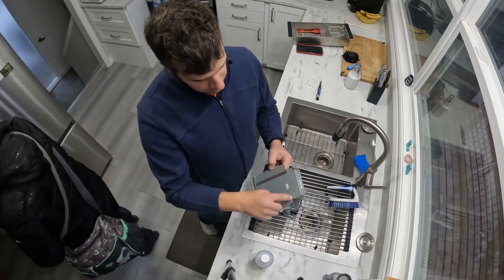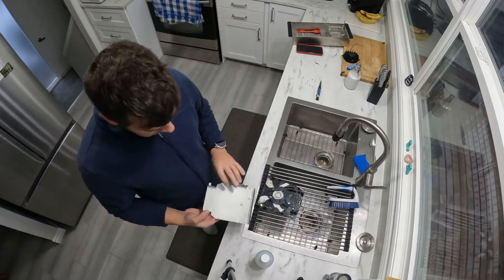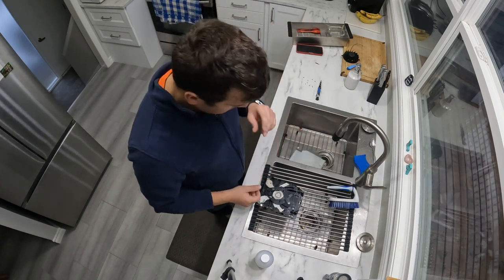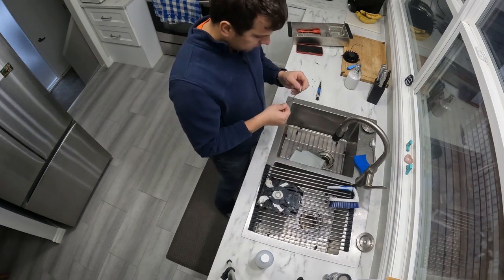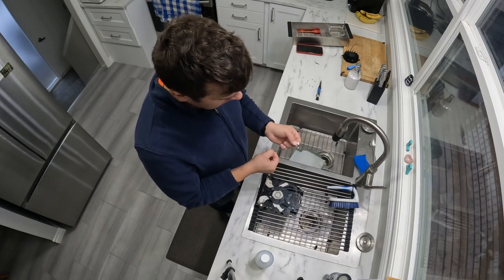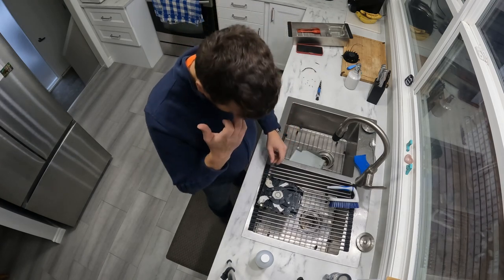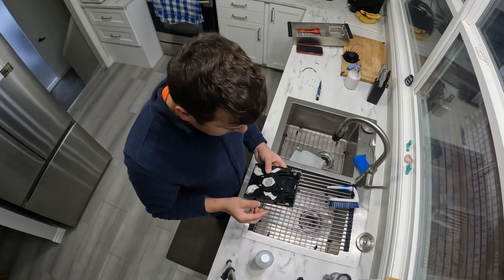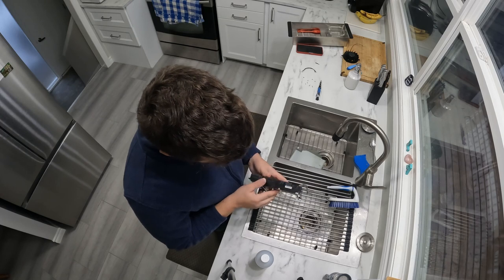So most of this top shielding will be cut away, and a very little of the shielding will be left to see. Don't forget to take off the 5-volt rail cord that goes to the main board on the PS3. Right now you see me there straightening out the wires, so when you put it back on, it looks very clean and aesthetically pleasing.